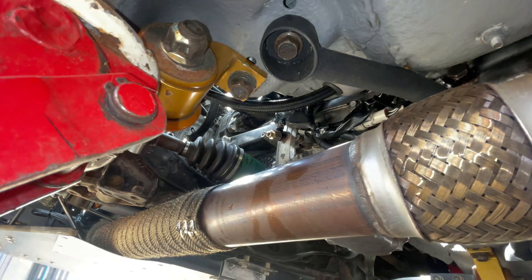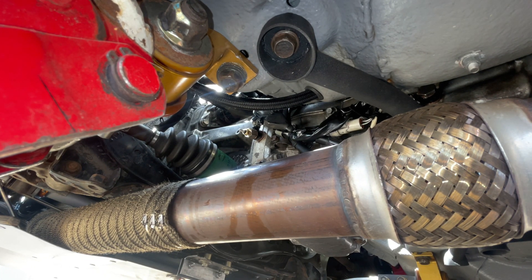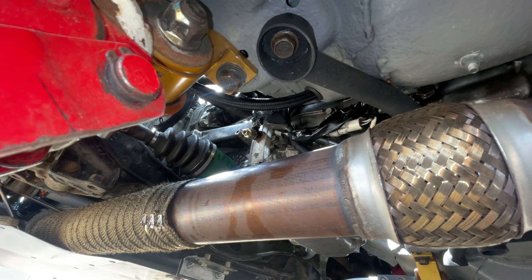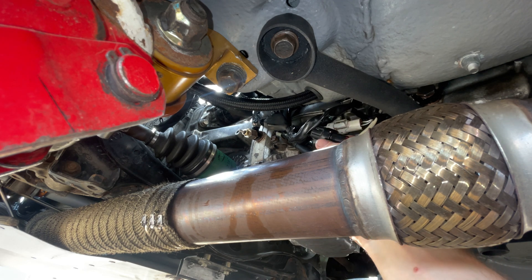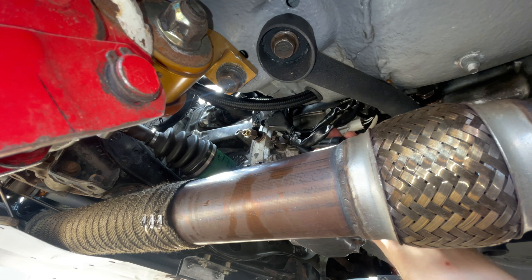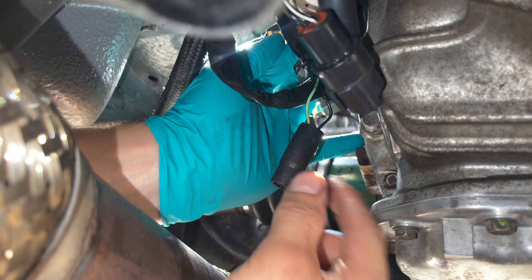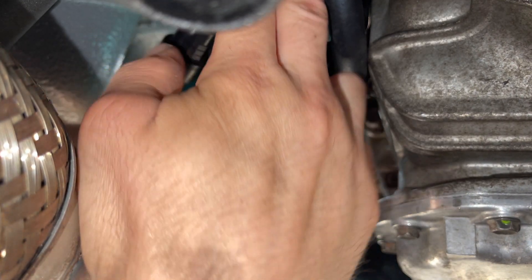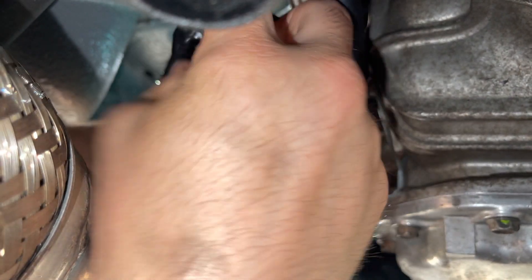The wiring is going to go off the neutral position sensor wire — not the rear lambda. The neutral position sensor wire is this black connector just here. I'm going to trace which wire it is back to the ECU. I need to disconnect that. That's the connector disconnected — this one goes to the neutral position switch. The other one is the reverse switch, so we don't want to go near that.